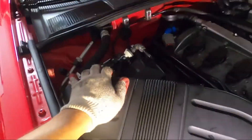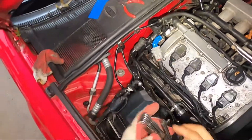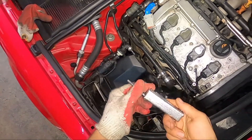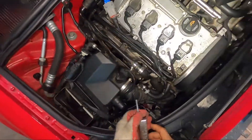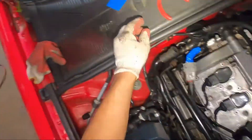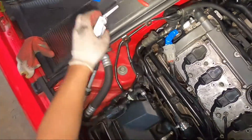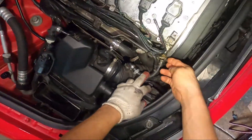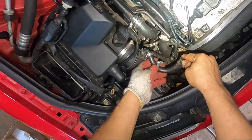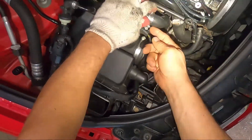So far, what I've got is a 5mm L-key. You're gonna remove five bolts just like this — five millimeter. There's one, two, three, four, five — five bolts total. Once you remove those five, you're gonna have a sort of clamp over here for this line right here. Remove that clamp, and there's gonna be another clamp on the bottom — remove that one as well.